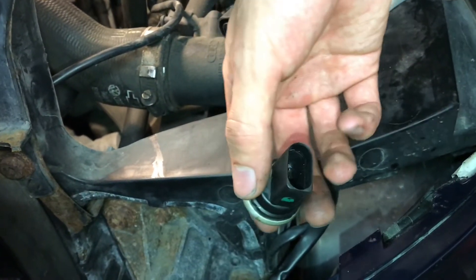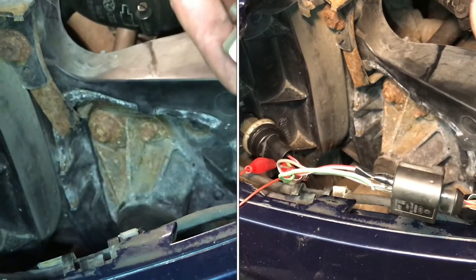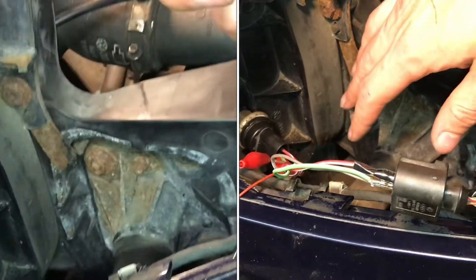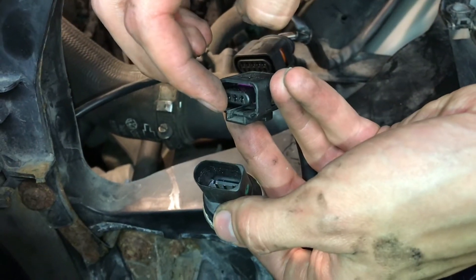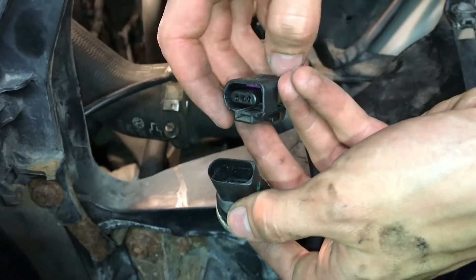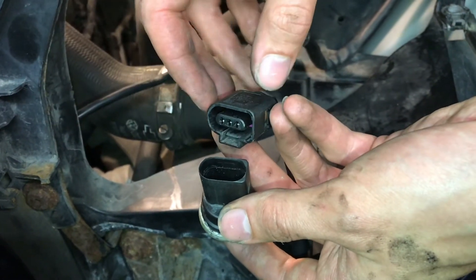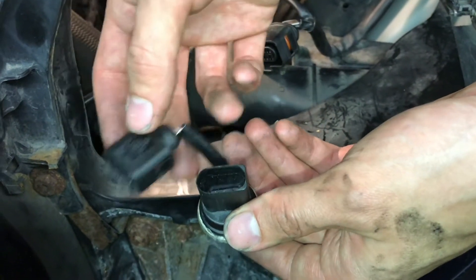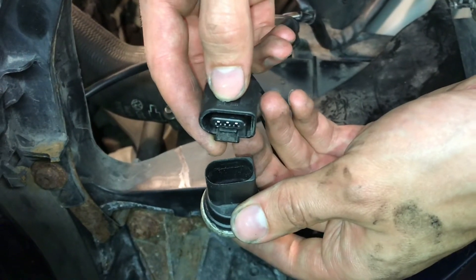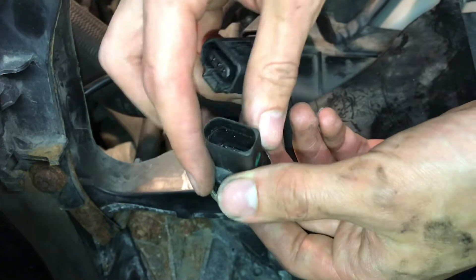The way that I did it, I almost didn't have to know the pinout, because I just connect from one side to where it's supposed to go and make sure I'm not crossing any over. That way I won't damage the sensor. But then in order to read it, you hook up your meter across ground and the center pin.